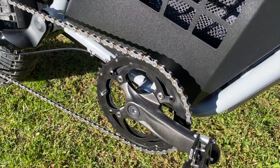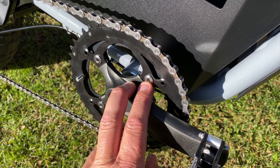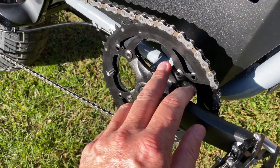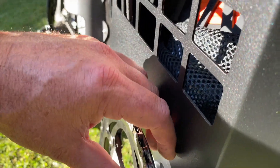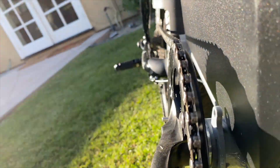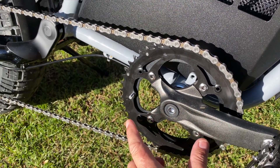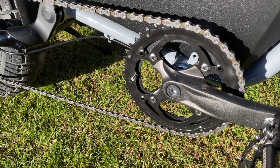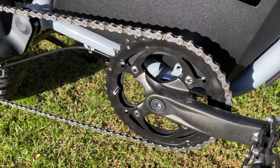Make sure when you order the bolts that you get single-width ones — the ones that come stock with the bike are double-width, typically used in setups with multiple chain rings and a front derailleur. To get past this, I ordered some new bolts but had to put the stock bash guard in place just to make up for the spacing. I have a new chain ring on order as well as single-width bolts. The chain ring I got off Amazon was the recommended item, but due to supply chain issues it's set up for a front derailleur configuration, which we don't have here.